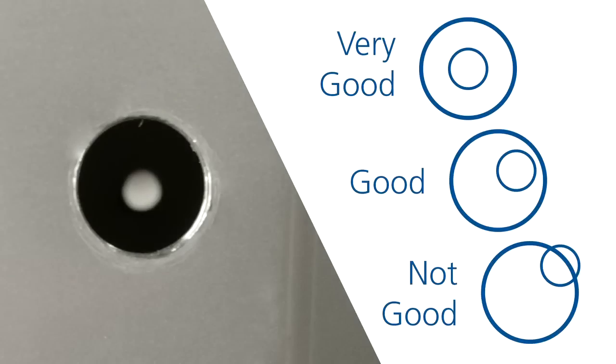If it's not possible to mark the inner door skin, we can make calculations where the two access holes should be. These holes are for access only, so they do not have to be perfectly in line with the holes in the door skin, however, they must surround the door skin holes completely.